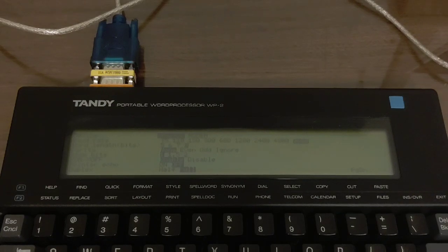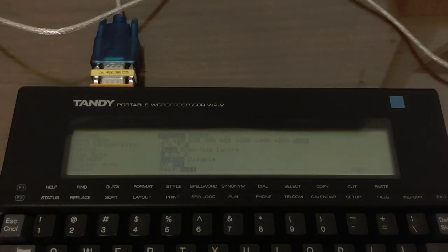Now let's take a look at the very simple terminal emulator. I'll try it out with agetty on my laptop, which passes a Linux console over the USB serial adapter. It does that with the appropriate termcap for this terminal emulator, a WP2 termcap, a link to which will be in the description. Before I do that, I'll make sure that the settings are configured properly here. I want RS-232C instead of the modem, 9600 baud.